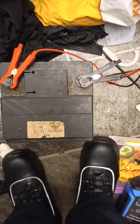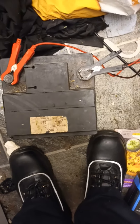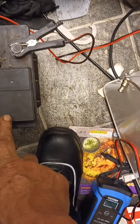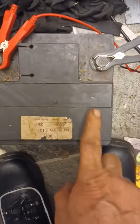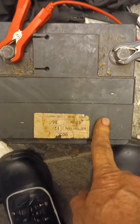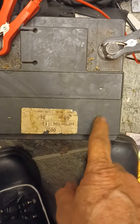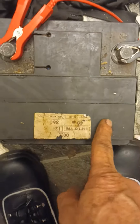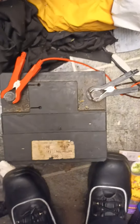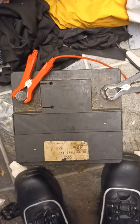Like I say, usually when the battery is flat the engine won't turn, because on a cold day it takes apparently 300 amps to turn a cold engine. That's what a 40 ampere-hour battery means — it'll supply 40 amps for an hour, or 1 amp for 40 hours. And 300 amps would drain that pretty quickly. That's why on a cold morning they watch that — it usually does your battery in. If your battery is about to go, a cold morning usually finishes it off, because it takes so much current out of the battery starting the engine.